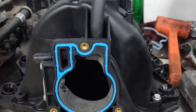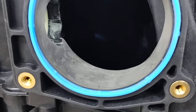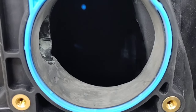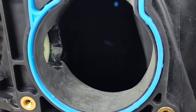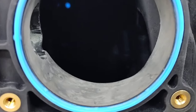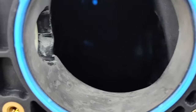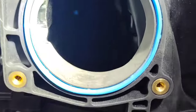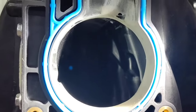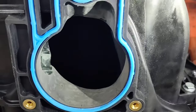We're going to see if it fits, but we'd already done a little port work on this thing. It comes apart in three pieces, which is really nice for porting. This thing originally had a lip in the throttle body hole. We went ahead and smoothed it all out, got it all nice — had a couple little ridges. I'll go ahead and put pictures of the inside here.